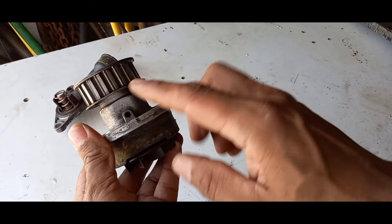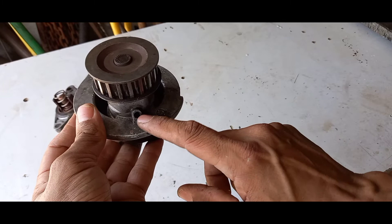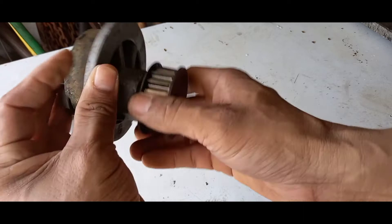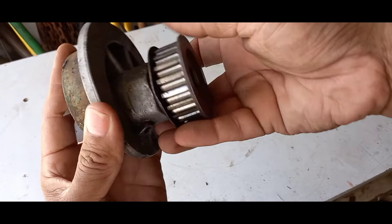You cannot really recondition a water pump — it's best just to buy a new one. One very important thing to watch for is the weep hole on the water pump. When you open up the engine bay, look underneath and find this little weep hole. If any water or fluid — green, brown, yellow, pink — comes out of that weep hole, your water pump is on its way out or already finished. Replace it immediately. That is a very important sign to look out for.